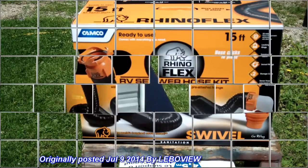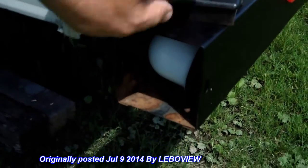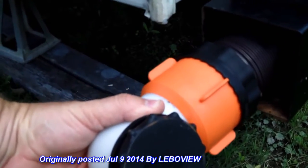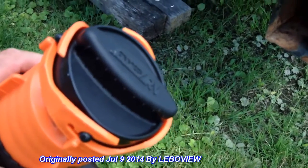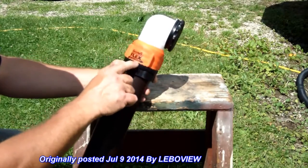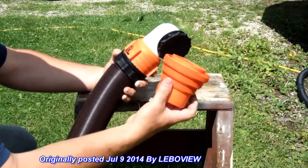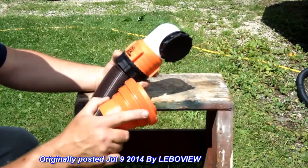I'm going to show you a couple things you need to look at when you first get it. We're back at the camper and you can see it's a standard square tube like everybody has. Pull the plug out — this is the four and a quarter by four and a quarter tube and this is the hose. There's a cap on there to keep it from dripping, and on the other end — the business end that connects to the camper — there's also a connector to keep it from dripping. Now, the bayonet is already attached to the connector when you get it. I've backed it off and taken it off, and that's the only way it'll fit inside the four and a quarter inch square tube bumper on the RV.